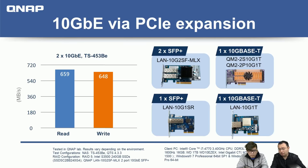Supported expansion cards include SFP+ interface (commonly found in data centers) and 10 Gigabit Base-T with RJ45 connection. QNAP also just launched the brand new 10G card called the QXG-10G1T, which supports not just 10 Gigabit speed but also 5G and 2.5G — five-speed support. We have another video about this 10 Gigabit card from about a month ago on our channel.